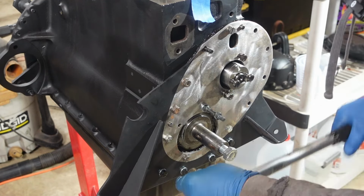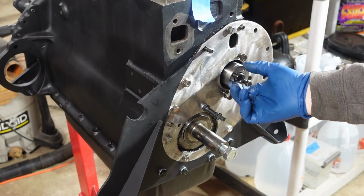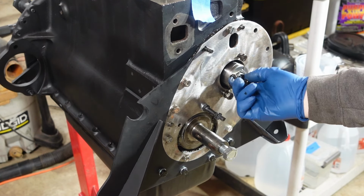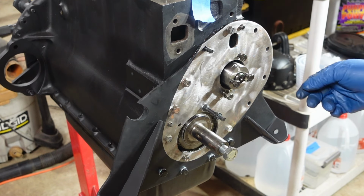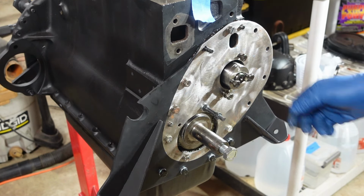Now you notice I edited all that stuff out. I don't have that front bearing anymore in there. If I push that camshaft in, it doesn't want to turn. And when I tighten that thing all the way down, it didn't want to turn. I don't remember. I'm going to look in the workshop manual real quick. I think there is an end float there that I just don't remember. So I want to look at that real quick. But it's turning now, but it made me a little nervous there because I couldn't turn the thing at all.